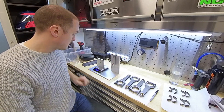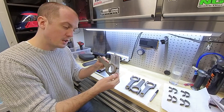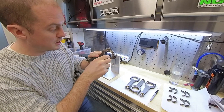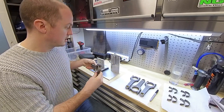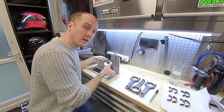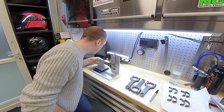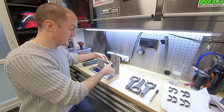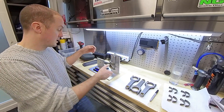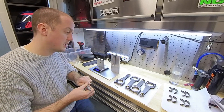I'm going to turn the scales on, set them to zero and weigh all of these. I'll weigh them this way up and then also rotate them 180 degrees and weigh them the other way up, just to make sure we're getting accurate readings. We need to make sure that the bearing doesn't get stuck on the joints between the cap and the conrod itself — if it does, we'll end up with friction in our weighing mechanism and it won't be accurate. You'll notice the conrod isn't actually straight when weighing; it's pulled over to avoid the bearing lining up perfectly with the joint. That way up, the small end is 144.4 grams. The other way up, also 144.4 grams — exactly what we want to see, meaning they're consistent.